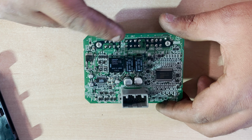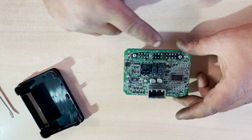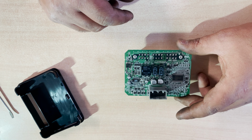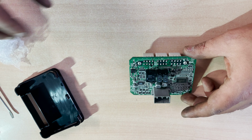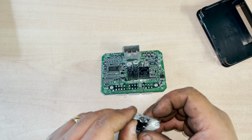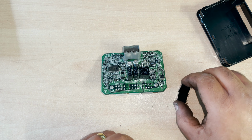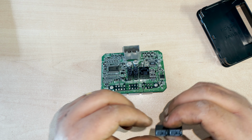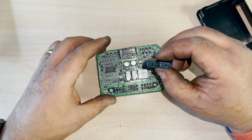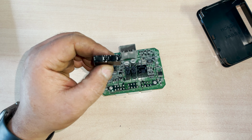Swapping them was a good decision because it eliminates any problem with the board. And if the right hand side started working properly and then the left wasn't, we knew it was the relay. That's exactly what happened. So I've got another two relays here, very difficult to find, but I managed to find two online, I think from AliExpress or something like that. They're gonna replace both relays, exactly the same one, G8N1FS. I'm gonna replace it and hopefully fix this problem.